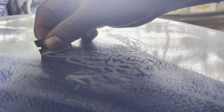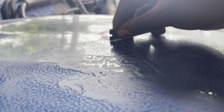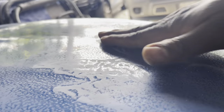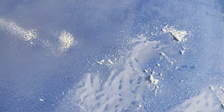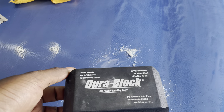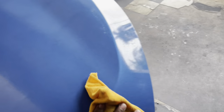I'm feeling with my fingers to check how it feels — a clean hand without gloves gives a more accurate feel. After removing the runs, I'll sand it with 1500 grit again. After a quick wipe-down and water spray, the surface is drying and those orange peel areas are becoming present again, but the surface is more leveled off. If pushing for show quality, I'd continue with the 1500 grit to level it more where the orange peel is less present.